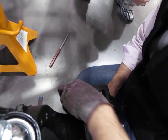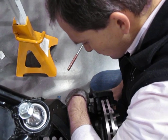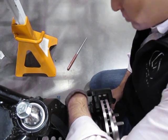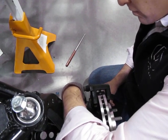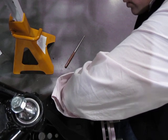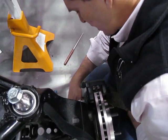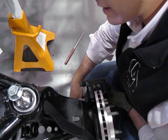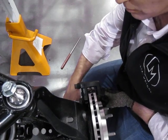Take the bolts with the yellow Loctite and put them down through to engage them. The torque spec on these — I believe it's 148 foot-pounds. Check the torque spec in the build instructions. Tighten them down to the torque spec and then mark them. That'll be the end of the step for mounting the brake caliper bracket.